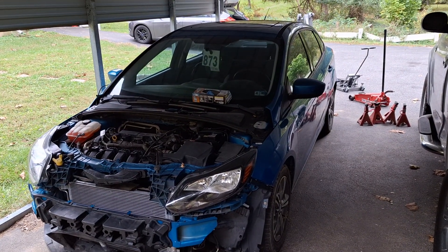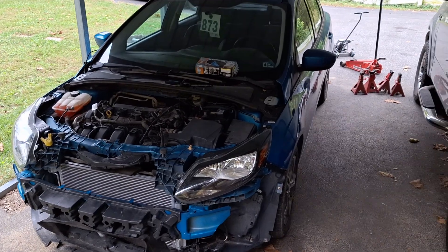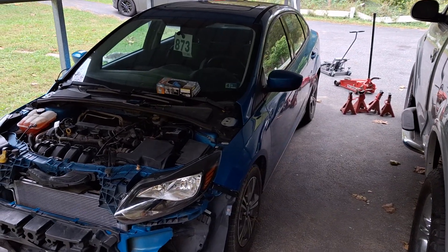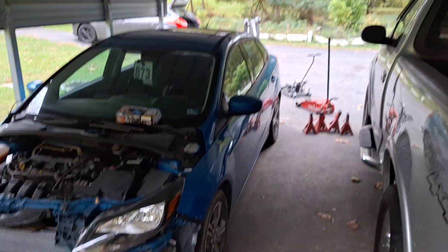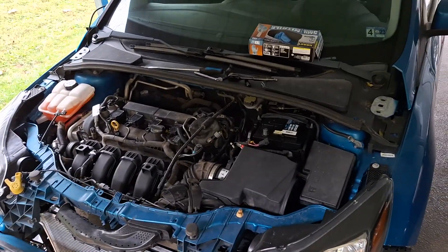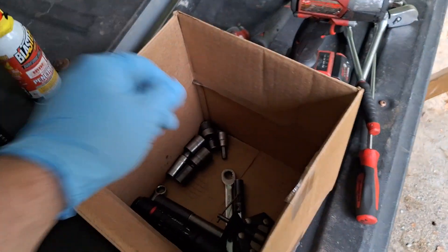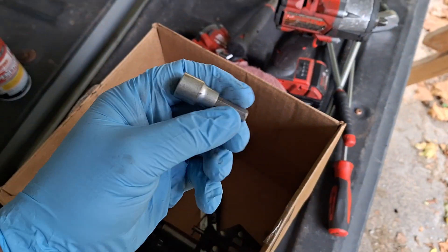2012 through 2018 Ford Focus DPS6 dual clutch automatic transmission DIY transmission removal at home in the driveway. Hood and bumper were missing — you don't have to pull those off necessarily to do this job, possibly the hood but we'll get there. You'll need a hex 8 millimeter for the drain plug, 3/8 drive ideally, and a swivel with a mid-deep 13 for the clutch nuts.